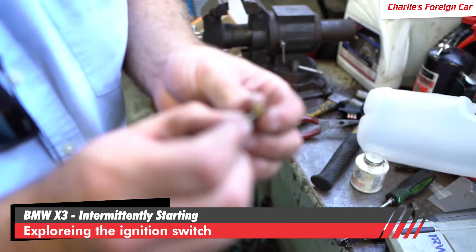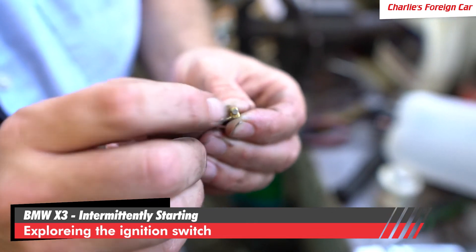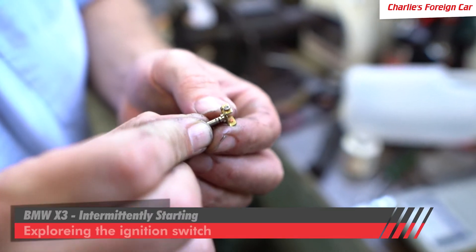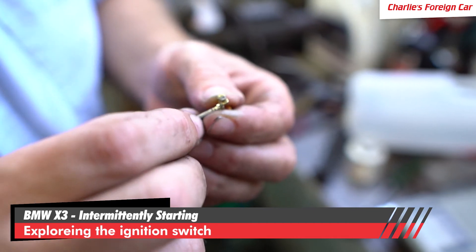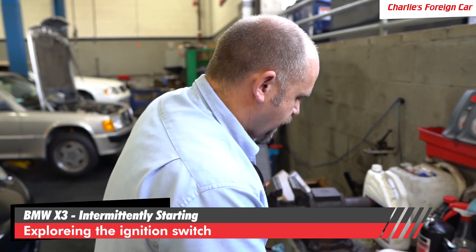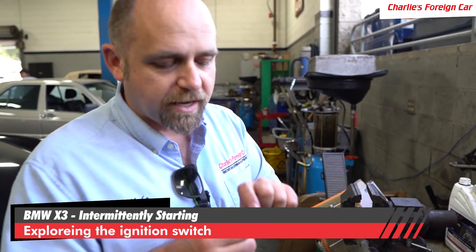There's three of them. The third one has a little tiny bit of a crater developing right there — flip it to this side, a little tiny bit of a crater there too. But if we look at our starter contact, look at that — that's bad. That's a huge crater. So it was intermittently not making contact. All kinds of things can cause this to happen. That is the inside of an ignition switch — you saw the bad contact point, that crater, and that will make your car not start.